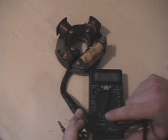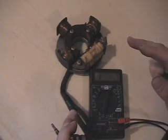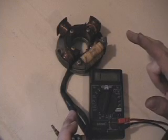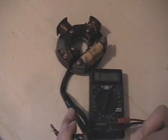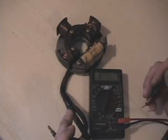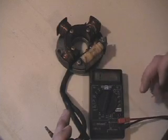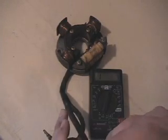I changed my ohm readings up to 2,000 on the multimeter. Usually these ignition coils are somewhere in the 120 to 170 ohm range. But if something is shorted or grounded out and gives a high reading like 500 ohms, I want to see that. If you're on the 200 range and the reading is over 200, it'll just say '1' and not register anything — that tells you there's an issue, but I like to actually see the ohm value.